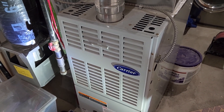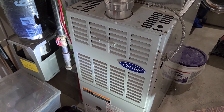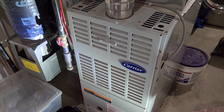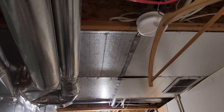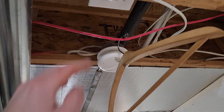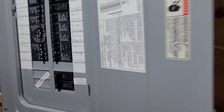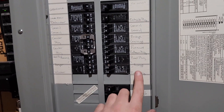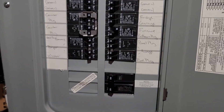The first step is before we touch anything in here, we're going to turn off the breaker and shutoff switch to make sure we're safe. I'm going to turn off my emergency shutoff switch here, and we're also going to come over and flip the breaker to the furnace — find it on your panel and shut her off.